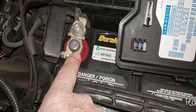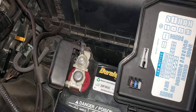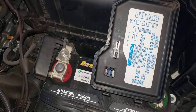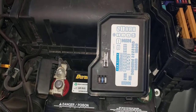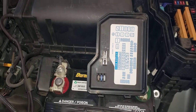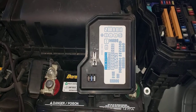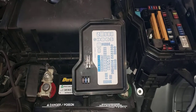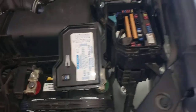This is the positive terminal. I'm going to have to come off of this with two wires, one to run the brakes, and one because I'm running 12 volts to that 7-pin hitch because I want that for my trailer as well. And there's no wiring in the car that's strong enough to run the electric brakes or the 12 volts to the hitch. So I'll get a 30 amp auto reset breaker and connect that to there.